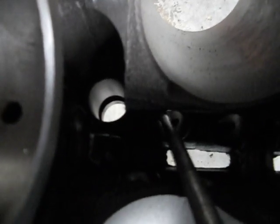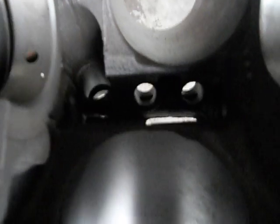And if you turn it around — say if we're going to attack this small one — right, there he is there. We'll just get it down there. You can steady it with two hands, just get it in there like that. And all we're doing is just taking that side bit out and just opening the hole up so it gets volume of oil.